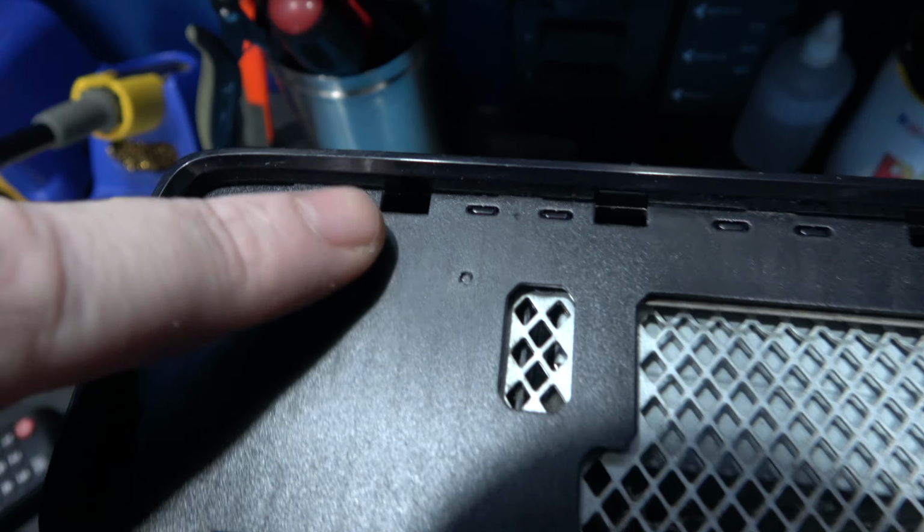Now, JRunner has just finished dumping the NANDs along with the JR programmer, and the most important thing you can see down here is that the NANDs are the same. If you do two dumps and it compares them both and they're not the same, do not continue. What you need to do is desolder everything, maybe shorten your wires, put everything back together, solder it back in, and then try again, because that's the magic you want there, where it says NANDs are the same.